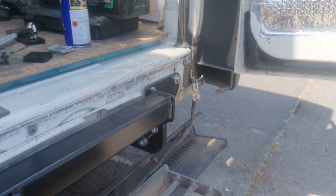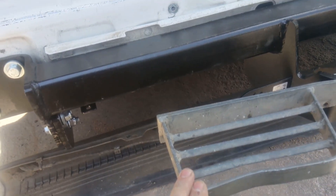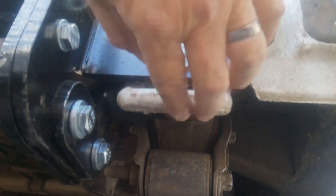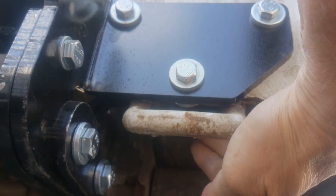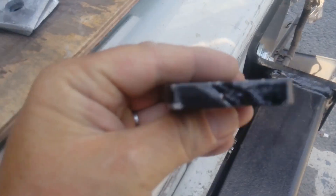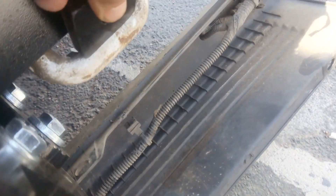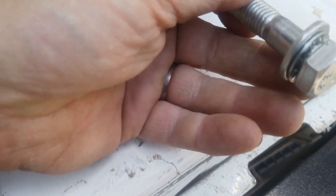So these are all bolted on both sides, as you can see over there. The electrical connections go through the parking sensors up there — I don't know if this is going to interfere with the reversing sensors. You get this part here — this side, because of this tow bar hook, is slightly different. So what you do is you get a different design bar, the instructions tell you how to do it, and you get two of these spacers that fit inside there. You bolt it with one of these bolts and a nut and a spring washer on there.